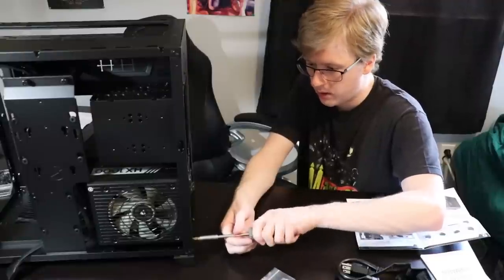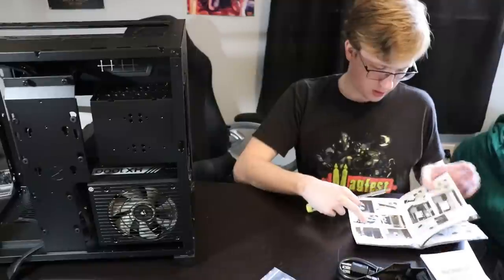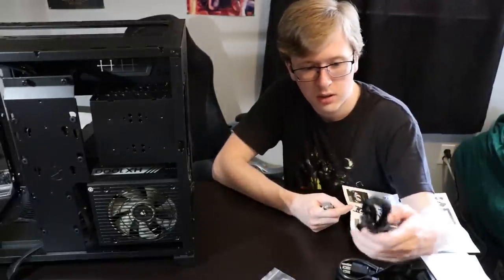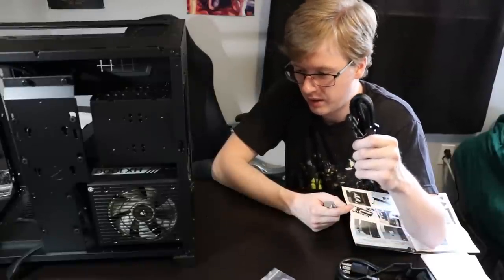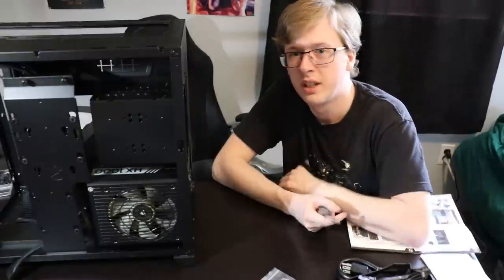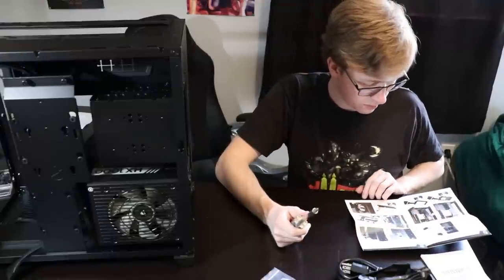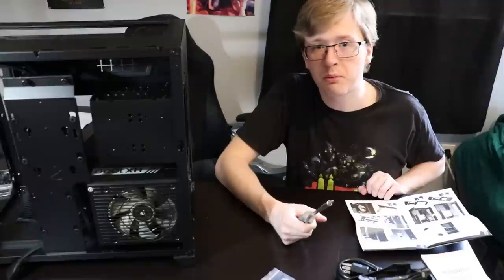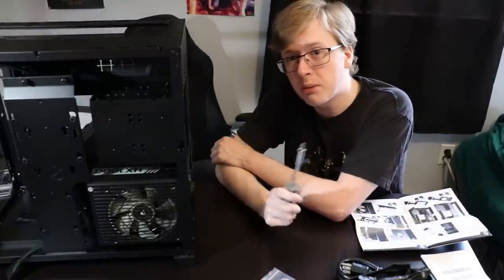Okay. Now that you've got those in, maybe I'll just do that in an X shape, and once I have that in, I will then figure out what to do with all the cables, because I should hook those up, at least mostly, and get that good to go. So I'll come back when we're on to the next thing, which should be either installing the motherboard or the solid states. Let's hook the motherboard. Motherboard will be simple enough. So I'll finish up with the power supply and then I'll be right back.